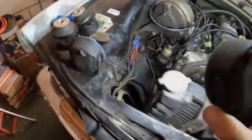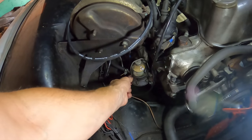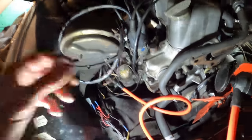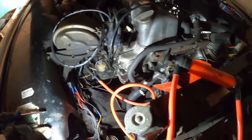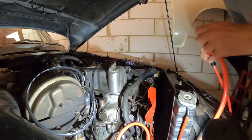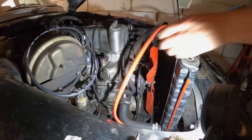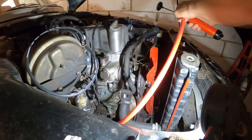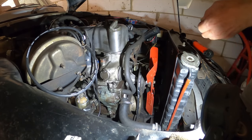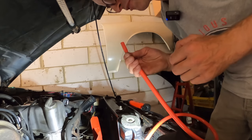Okay, positive start. Back to the initial problem — there's no fuel in the pump. I'm going to have to do the whole sucky thing again, aren't I? Didn't really fancy doing the old mouthful of petrol thing again. The battery's gone flat so I've hooked up the pump I left over here to try and suction some fuel through this way. It's not working — I'm going to have to do the old manual sucky thing. Yuck, there's nothing worse; even just the fumes are disgusting.